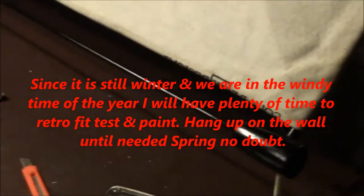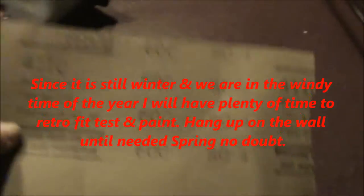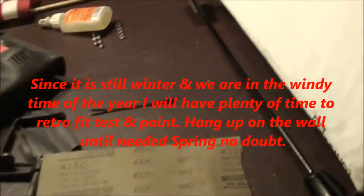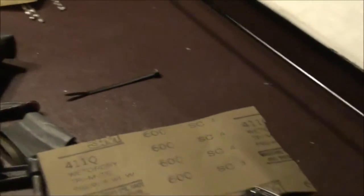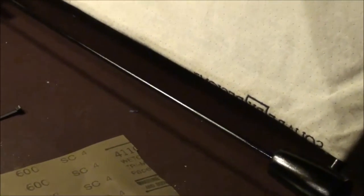I ran out of paint, so it does need another coat. I need to go over it with some 600-grit sandpaper and then paint it again. I think I went over the last one with a 220 — so I'm just going to go down to 600. It's really easy to tape off, so I can tape it off, repaint it, take it off the bike to paint it. I still need to get some orange paint, but it's getting there little by little.